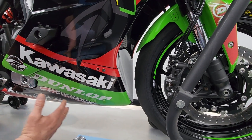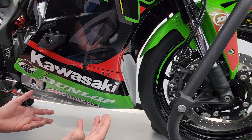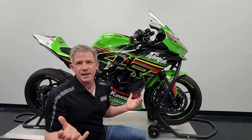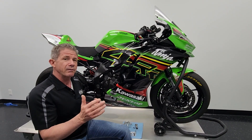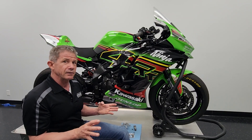When you do that, you have less airflow over the engine. Kawasaki designed this bike so the engine cases would help disperse the heat from inside the engine. Normally on the road, you wouldn't be sitting at 16,000 RPM sustained down a straightaway making 90 horsepower — you'd be making 70 horsepower and cruising in the mid-range of 5,000 to 8,000 RPM. When you build the race bodywork, it holds in more heat; more power makes more heat; higher RPM makes more heat. The oil temperature is critical — above a certain temperature, the oil stops working well and the rings don't seal.